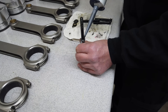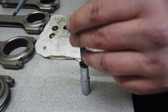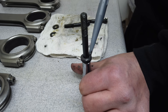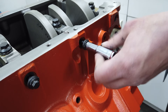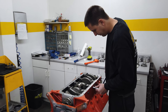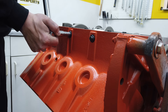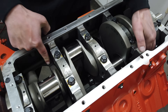With that done, we can move on to the cross bolts for the main caps. The cross bolts secure the main caps through the skirt of the block. If you aren't careful, oil can weep past the bolt and drip down the block. To keep this from happening, Cody applies a thin bead of silicone underneath the head of the bolt and also underneath the washer before threading the bolt into place. This process can get messy, but using a socket to hold the bolt while you apply the silicone definitely helps. The cross bolts are smaller than the main cap bolts, so they are only torqued to 40 foot-pounds.